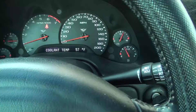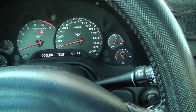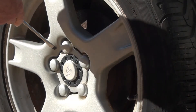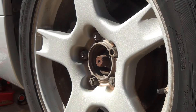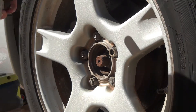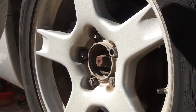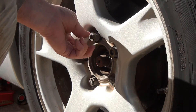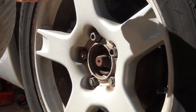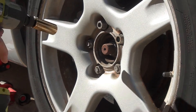As soon as the temperature comes up a little bit I'm going to go ahead and move it and get to the tire. I'm going to take the hub cap off first — it's really easy to do. These are 19 millimeter. I don't have an impact socket right now so I'm going to use a regular one, just wanted to break them loose. They're on at a hundred foot pounds, so I didn't want to take them all the way off. I'll put the tire in the air before I take them off.